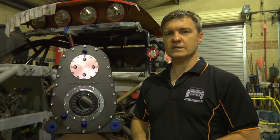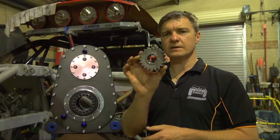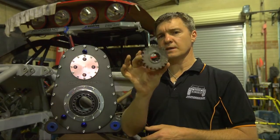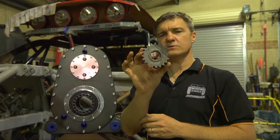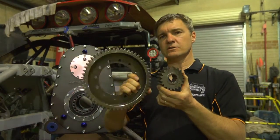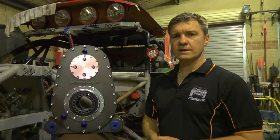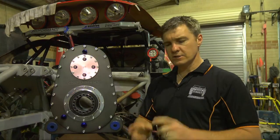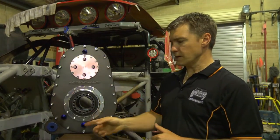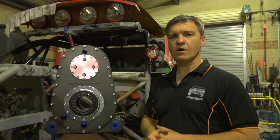The quick change gears in our transfer case are a bit bigger than what most people would be used to. Looking at your traditional speedway sprint car quick change rear end gear, they're a reasonable size — those things handle 800 to 900 plus horsepower. If you look at the difference in size of our gears, you can imagine the sort of horsepower you could push through a much larger diameter gear. We recommend running all the oil of the transfer case through an oil cooler — it only needs to be very small, but something to remove some of the heat. Our transfer case is fitted with oil pickups, scavenge lines and vent lines, ready for a high performance oil cooler.